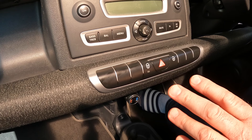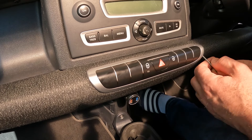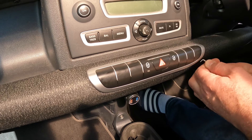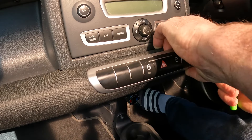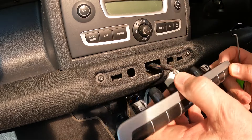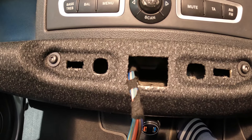To begin with, this switch panel needs to be removed - we need to remove the entire switch panel, not just the fascia, which sometimes wants to come away by itself. This reveals a T25 screw in here.